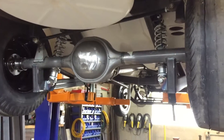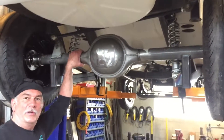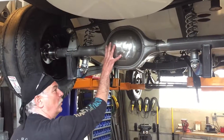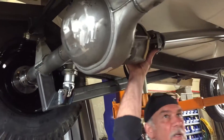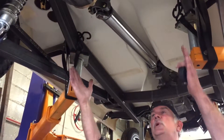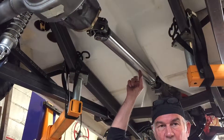I had this housing made special — it's a 9-inch Ford, which is what the race guys like. It's pretty heavy duty, 31-spline. What's different about this Ford rear end is that I had the U-joint located in the center. On this particular car the tunnel is exactly in the middle, so I had this rear end built with the driveshaft located in the center so I wouldn't have to modify the body for the tunnel.